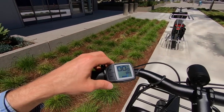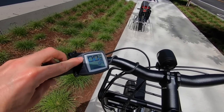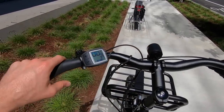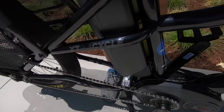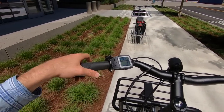That range estimate is based on the last mile or so of riding with me — a relatively lightweight, fairly active rider. You can go a long way on these bikes, which reflects the efficiency of a mid-drive leveraging the rear cassette. With 10 speeds and the trigger shifter — two-way high multi-shift — it's one of my favorites. Going all the way up to Turbo mode, the range drops to 37 miles. Tire pressure, wind, hills, weight, and cargo weight all factor in but it updates dynamically as you ride. There's also a walk mode.